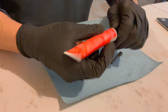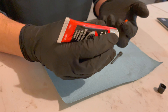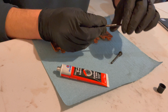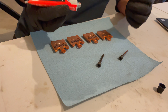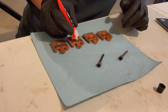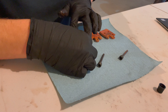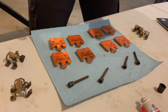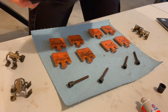Now it's time to lube everything up. I have some silicone-based brake lubricant — I'm just going to add a little bit to my finger and lubricate along the pin here. We're also going to add a little bit of lubricant to the back of the brake pads. Very important that you do this on the back and not the front — otherwise you're not going to stop. I went ahead and finished up the rest of the brake pads. The first thing I'm going to do is chuck out these gloves because I really don't want any of that lube getting on the friction material or the rotors.